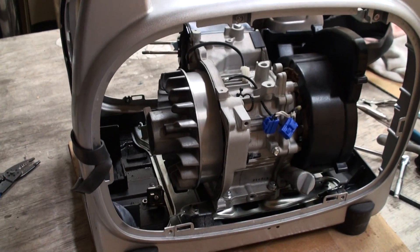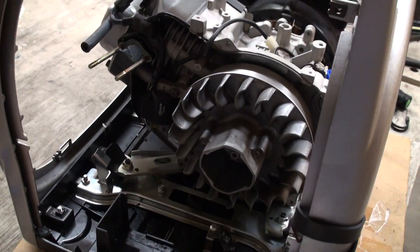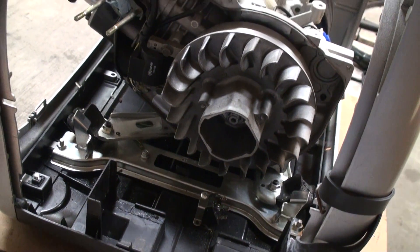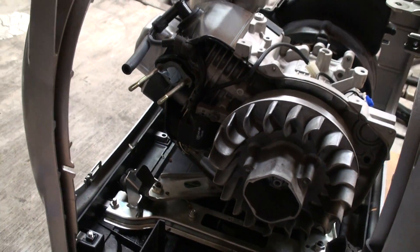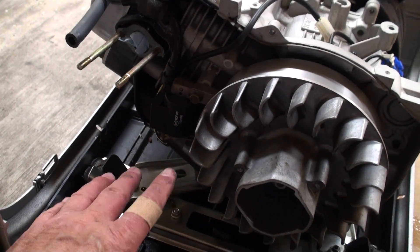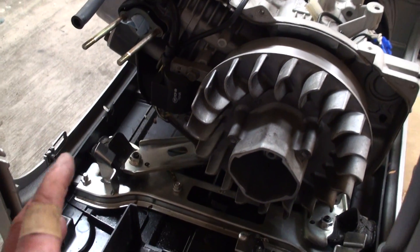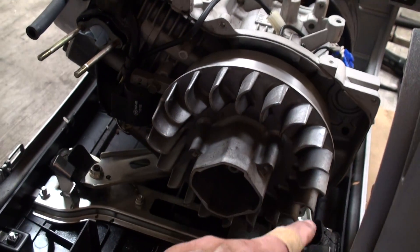I think I got it fixed. It's not too hard to get the front apart — the carburetor just has two nuts, there's a bolt in the cover here, and then the air filter and all that stuff comes off with just a few bolts around this cover.